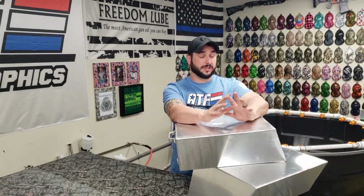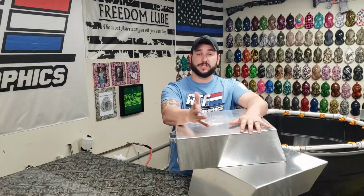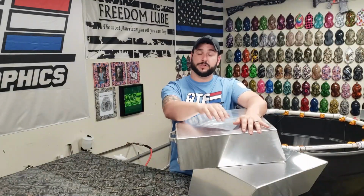The reason that we're installing these float pods is because I have a motor build that's going to be quite heavy on the back of this boat, and I don't want the back end to squat. So this is going to be used to add extra flotation and buoyancy on the back of the boat and keep the back end up once the motor is installed.